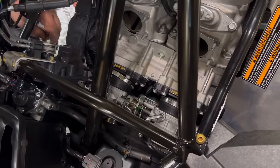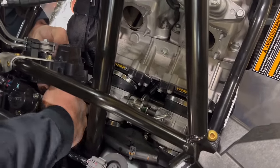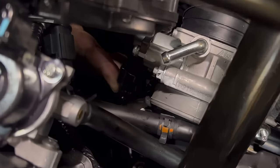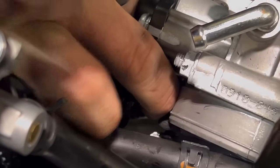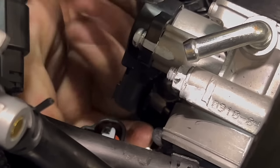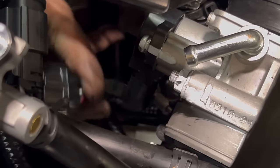So we're removing the throttle bodies. You're going to want to unplug the throttle position sensor. If you can get your hand in from this side, there's a clip on the side. I don't know if you can see where my finger is. You have to pinch it, which can be a little bit of a trick, especially with a gimpy thumb. Once you get that off,